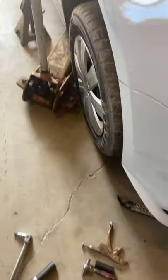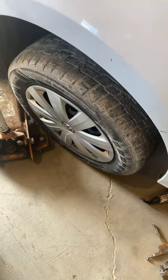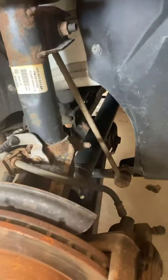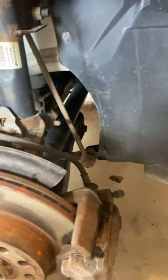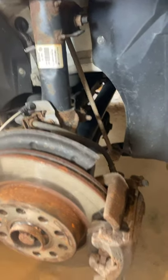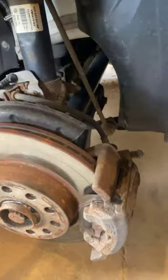The first thing I'm going to do is take off the wheel and tire. Pretty straightforward — jack it up, support it with jack stands, pop off the hubcap and remove the tire. Okay, wheel has been removed. Just wanted to give you a sense of what we have to disconnect. One thing I did want to bring up — you want to jack up the other side of the car because this sway bar that you have to disconnect provides some pressure. When the other tire is on the ground it's going to put some pressure upwards, so it helps if you jack up the other side. At least get the tire off the floor — makes things a little bit easier, especially when you have to bring the assembly down to get that strut out.